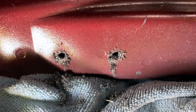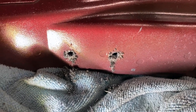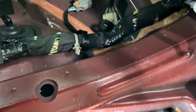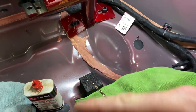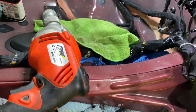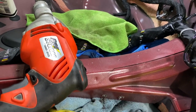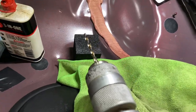I slowed it down even more and really leaned my hip into it — it cut through way quicker with the quarter-inch bit going slow with a lot of pressure. Now I had to drill the back sides. Success on the back side: slow rotation, lots of oil, stopping frequently to add more. I put towels over the wire harness and stuffed rags behind to catch oil and filings. Two holes done. Each hole took maybe two to three minutes. The bigger bit versus the smaller bit is key.